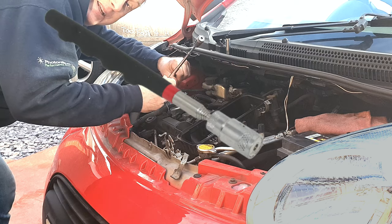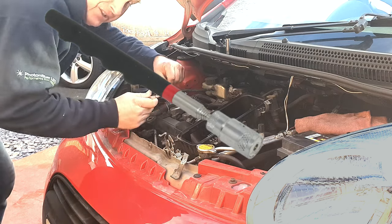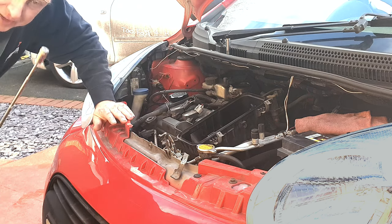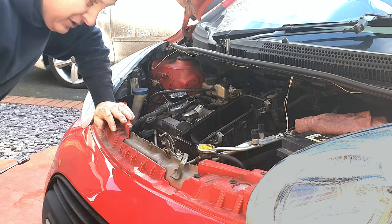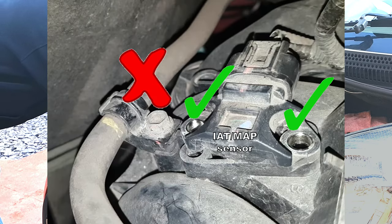It's also a good idea to have a magnetic pickup handy, so if you drop either the tool or the screws down the back of the engine and they land on the floor, you can just go underneath and pick them up — saves a lot of stretching and reaching. Also be sure you're undoing the correct screws; it's very easy to undo the screw that holds the vacuum pipe in place by mistake.